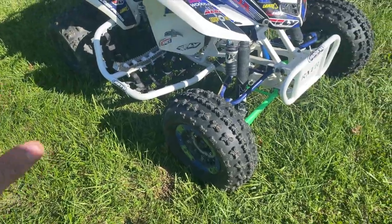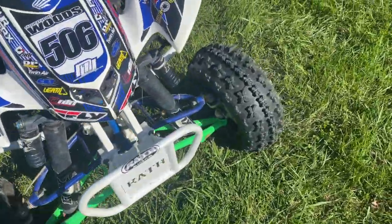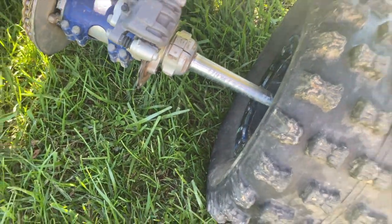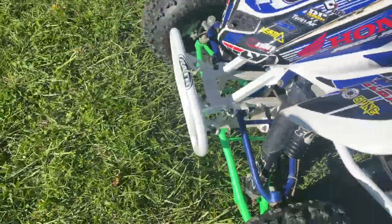As of right now, I'm going to play with it, going to Ironman this weekend and ride it and kind of dial it in. But first, we have to address the issues it has. Now, if you have eyeballs, you can clearly see these tires are flat. 3 out of 4 tires are flat. I know this one has a plug in it, and it's right on the corner of the sidewall somewhere, which is unfortunate because that's like the worst place to have a plug. But this is the only one that holds air. So that is what I'm going to be addressing today.